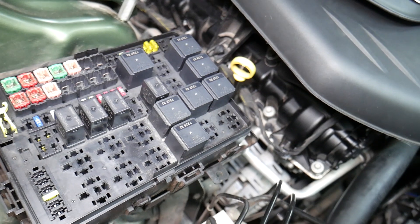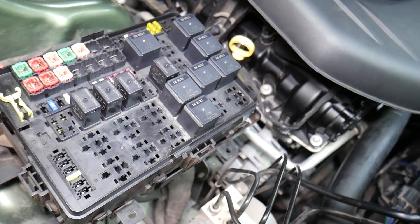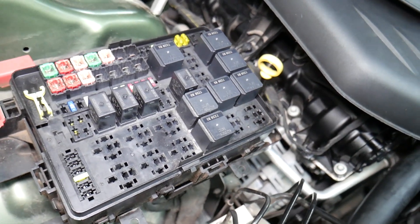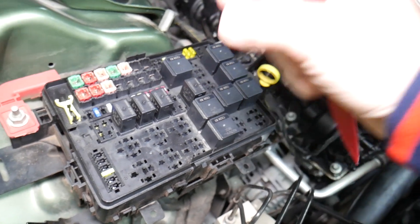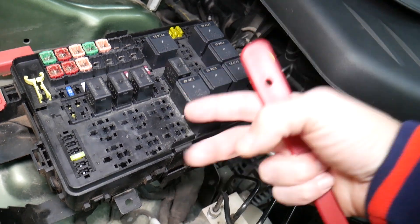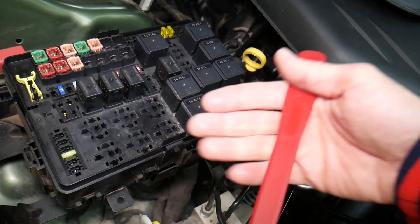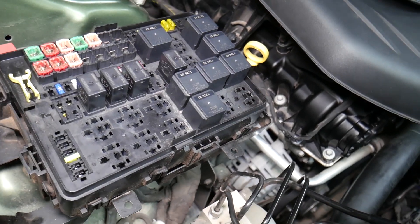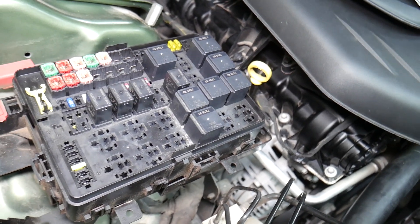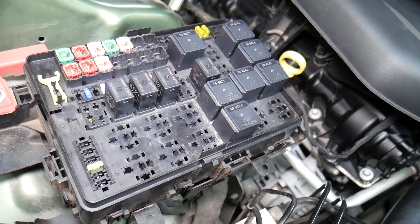For instance, when working on airbag fuses or anything like that, you need to wait at least one hour after disconnecting the car battery. And if you're not qualified and certified to work on the airbag system, I would never recommend you do that. When disconnecting the car battery, a common mistake people make: it's important to know which battery terminal you disconnect and reconnect first. If you do it the wrong way, you can burn electronics modules. We know because we burned the traction control module on a BMW before — that cost $2,000. We'll put a link in the description on which battery terminal to disconnect first.